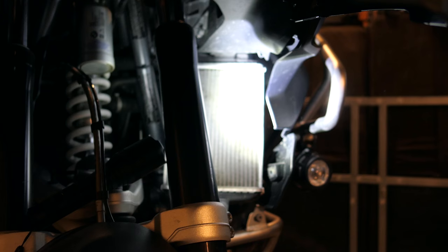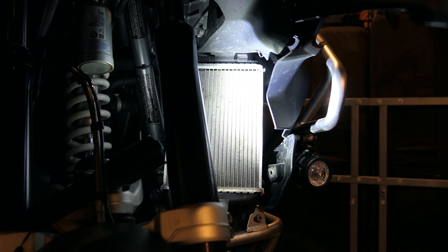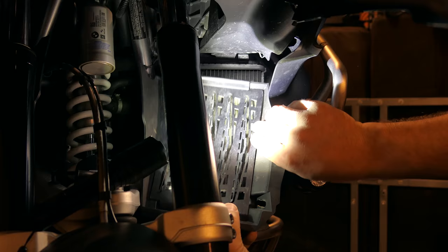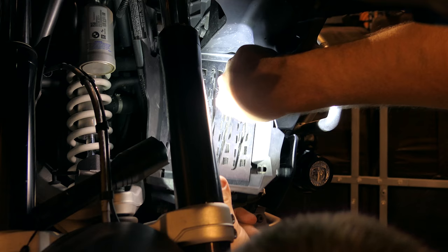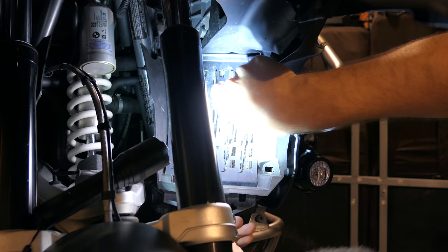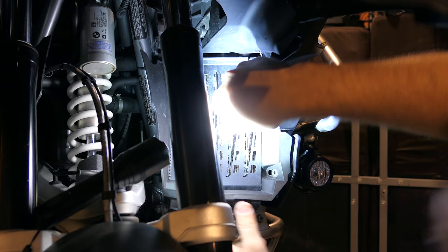When you go to reinstall, there are some tabs up here at the top. So you want to make sure that you've got your spacer and your bolt staged. Before you do anything else, you're going to bring this up into those tabs — just like that. Then find your tab at the top where the spacer bolt is, grab your 3mm Allen, and go ahead and secure that down. At least get it started — once you get it started, you're golden.